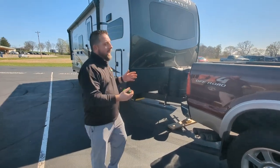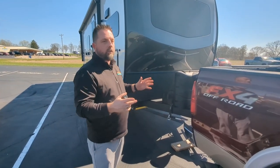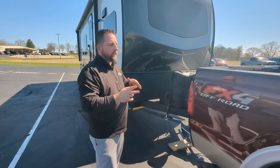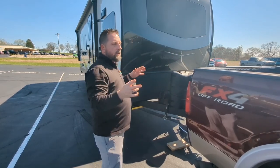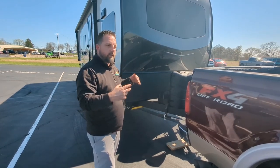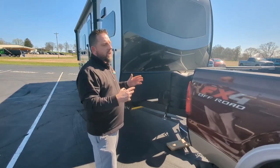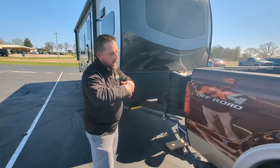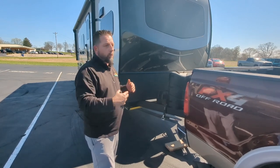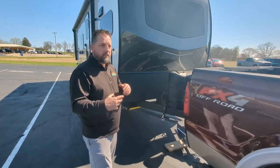The reason you do that — if we have too much weight off the front of the trailer and the back of the truck, it's going to make for some weird pulling. You're going to get a lot of swaying behind you because you forced that weight too far on the outsides and there's nothing to control it. The sway part of this is going to struggle a little bit to keep up, and it's going to give you some chucking and bouncing. If we didn't have enough of it and the truck is really squatted down, the sway control part is not going to work hardly at all because it's going to be forcing those bars too much. This thing is just going to feel like it's all over the place behind you. So it's important to get it in that spot.